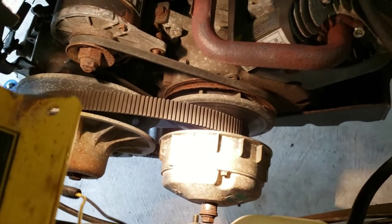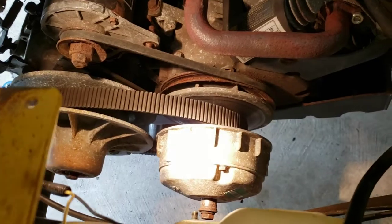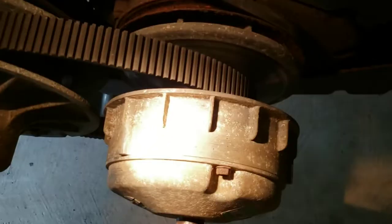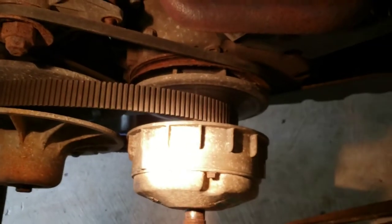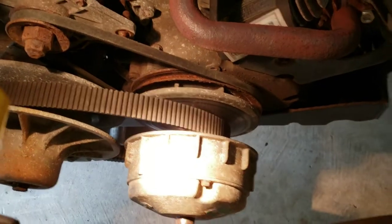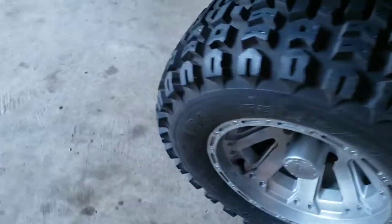So in this video, I'm going to rebuild that centrifugal clutch and see if I can address the problem. I bet it's just some kind of buildup inside, not allowing the clutch to move all the way in and out freely. So to get started, we jack the vehicle up,